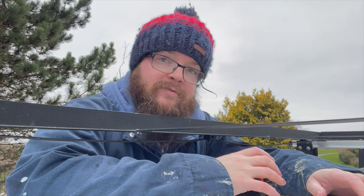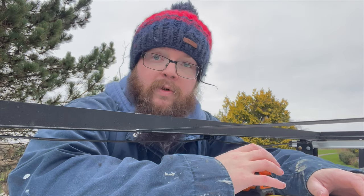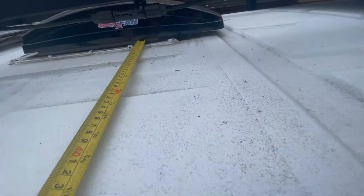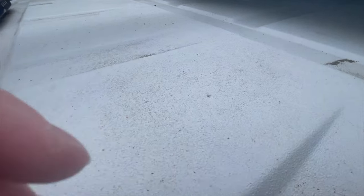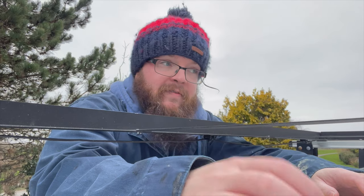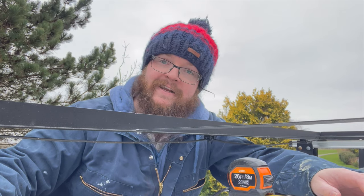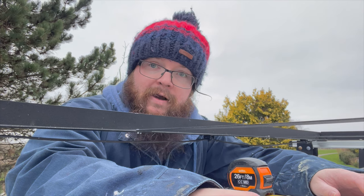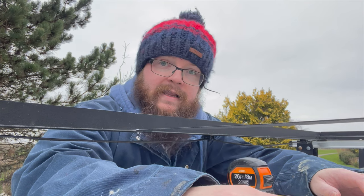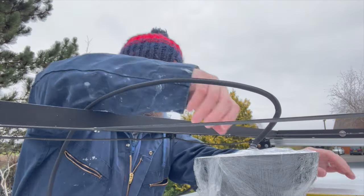I need to take into account where it's going to come in inside the van itself. What I've done is measured from a datum — the Maxxair fan inside the van — and figured out how far it needs to go to get inside the cupboard. The instructions say to drill from the inside out, so you know where it's coming from inside your van and popping out through the roof. I just want to double-check that because I don't want it coming out on the side of my roof or too close to the edge. Measure, measure, measure — do your predicting first.